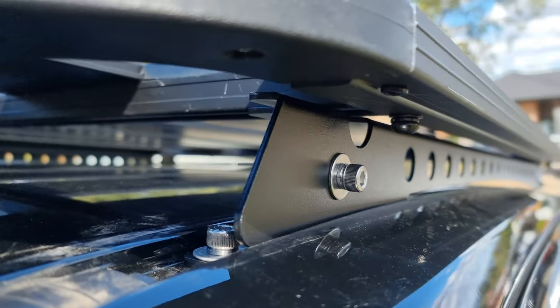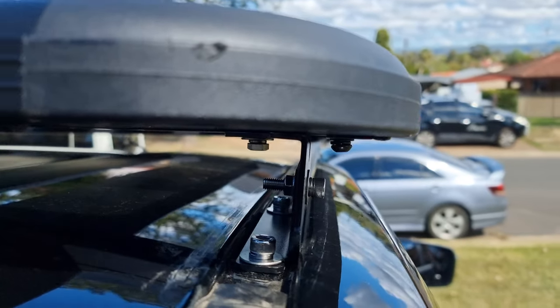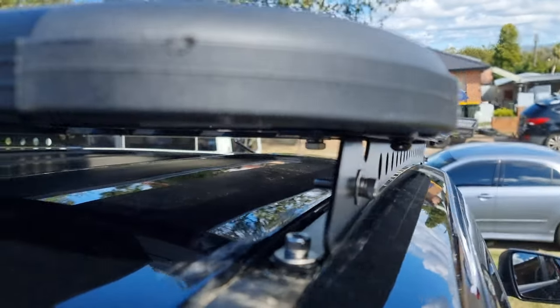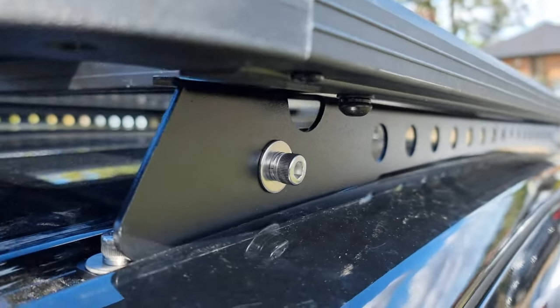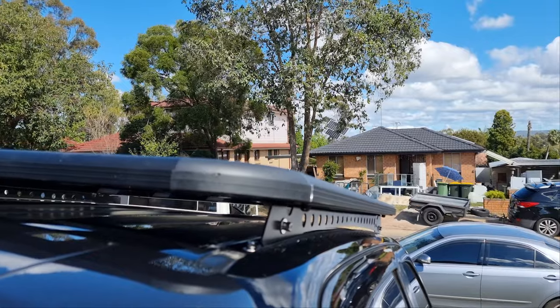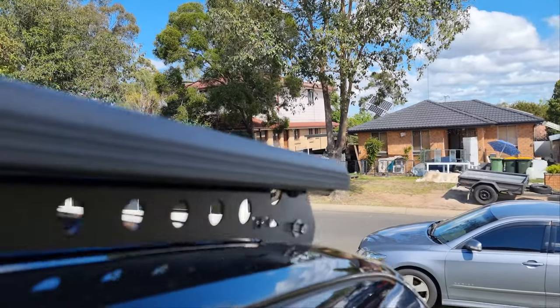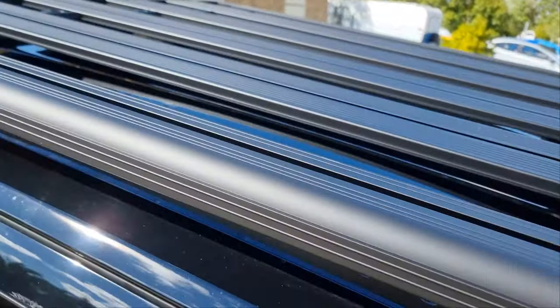Or, if you can, do it with two people — that way there's less chance of anything happening. You may also want to put a sheet or a towel down to protect from minor scratches. Once I had the roof platform in place, I then proceeded to put the bolts through the rails into the body mounts. I kept the rails on the outside of the body mounts. Once all the bolts and nuts were in place and everything was square, I went through and tightened up everything.